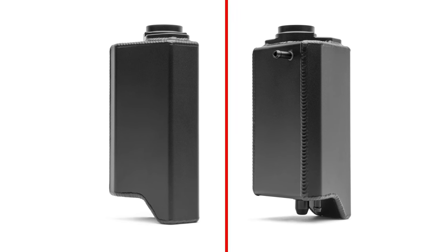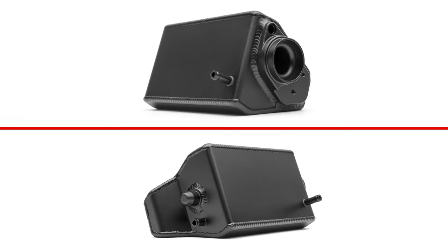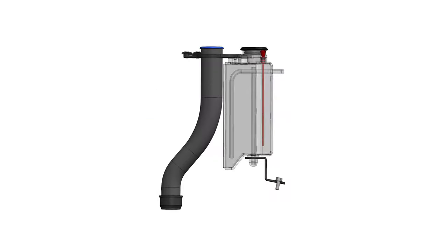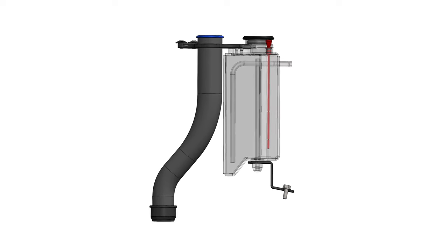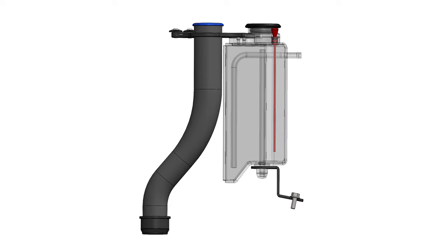The Cobb version features a 1.1 liter capacity all-aluminum tank with beautifully TIG-welded construction and sleek black anodizing. Using x-ray vision, or a fancy computer rendering, you can see the internally welded fill and vent tubes that manage the contents of the tank.